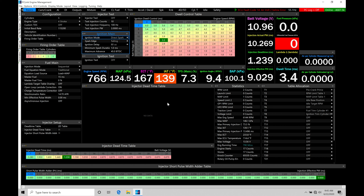We're going to be taking a look at working with our closed loop style boost control within our PC Link software. In our last video, we explored our open loop style boost control. The open loop is where we just program a certain amount of duty cycle we're going to be sending to the boost control solenoid, that's going to allow us to turn up the boost past our wastegate spring level.